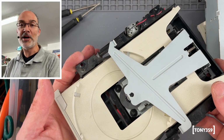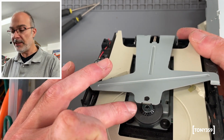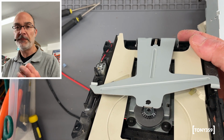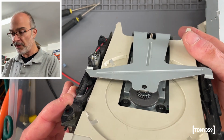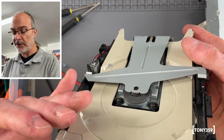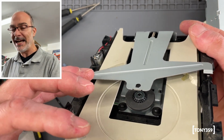Right, I think I figured out what the problem is. So this little disc of metal where the actual CD is resting is a magnet, and the idea is when the drawer closes, it's attracted by this piece of metal here, so it makes a firm grip. And I couldn't understand what was going on, because when I closed this, the magnet is just doing its job, and the reason why the motor doesn't have enough strength to pull out the drawer itself is that the magnet is too strong. And then I realized, wait a minute, there should be a plastic basket here.